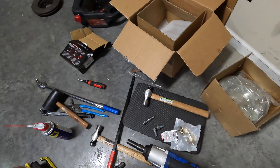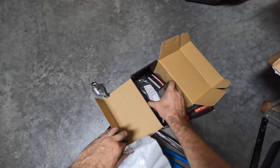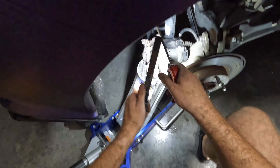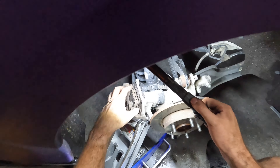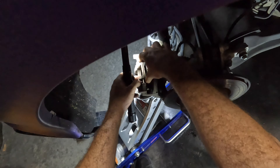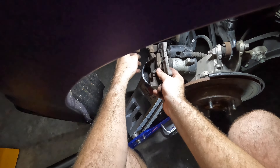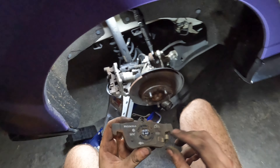Checking whether the springs get replaced — they do. Those springs definitely come out. I'm going to assume we just pry the big ones out — yeah, you can just pry these out, not too bad. That basically loosens up the pads. From what I can tell the pad will slide out. You do have to rotate the pads to get them out because of the wear indicator.